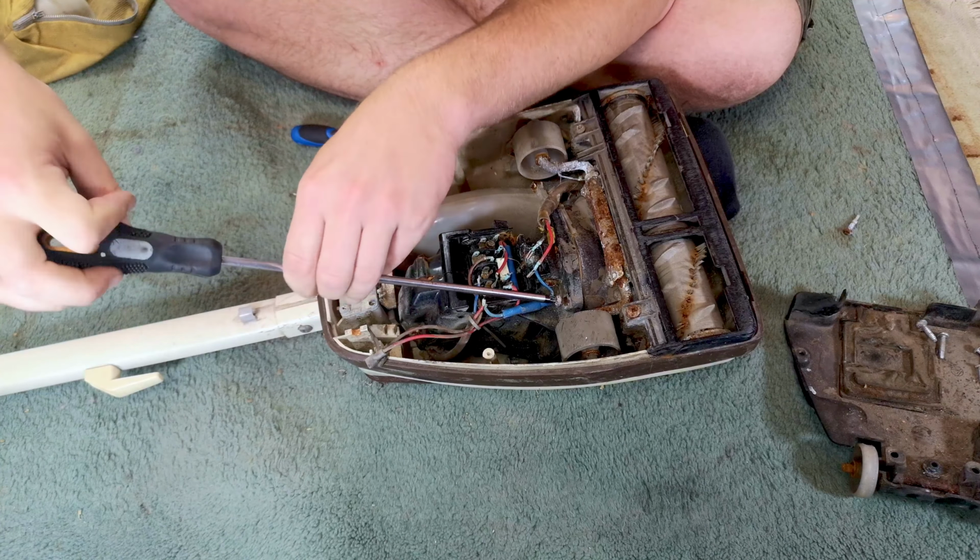And now what you've got to do is get in at an angle to the remains of the outer shell of the bearing and then smack it out, and it's very difficult. You get little ball bearings absolutely everywhere, and you've got to not crack, if you can help it, this. It might take a few screwdrivers, it's better outside as well, but we'll be alright.